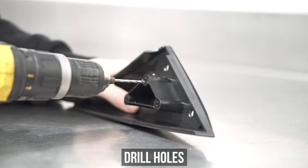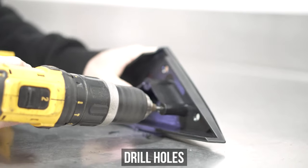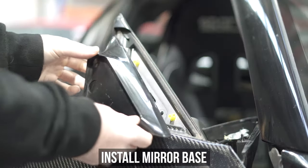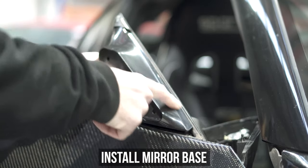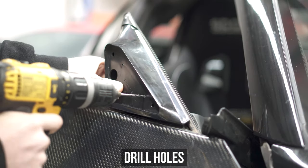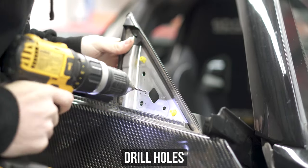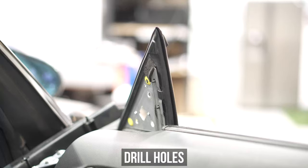Match up the R or L bracket to the side you're working on and get a drill handy. Using the drill bit size shown on screen, pop a few holes in from the back to the front of the bracket as shown. Now head over to the car, tuck that little corner into the rubber pouch, making sure the line from the door matches up with the line from the bracket edge. While holding the bracket, run the drill through the holes from the front to the back this time so you make marks on the middle of the door. Then drill three pilot holes where you made your marks, and go back through with the drill bit size shown on screen to widen those holes out.